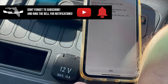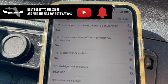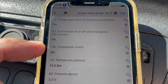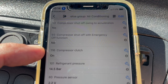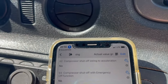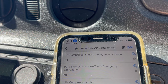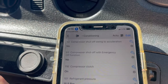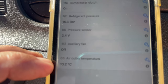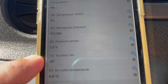Compressor clutch is on. There are several things that will turn that off, such as low Freon level, incorrect temperatures at various different places — temperatures are checked all over the place on this thing. Heavy acceleration or wide open throttle will shut the compressor off to give you more power to the engine. You'll notice right away this is 15–16 bar — that is good cooling pressure. Our air outlet is already down to 10 degrees, and this has been running maybe three or four minutes. Auxiliary fan right here — that is the condenser fan we talked about out in front of the radiator.